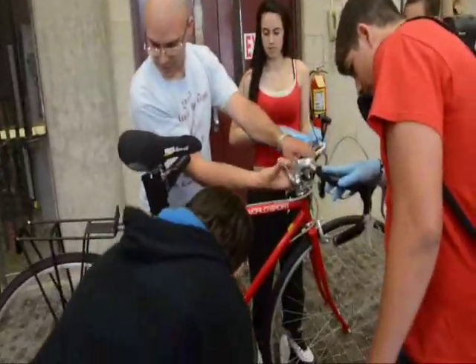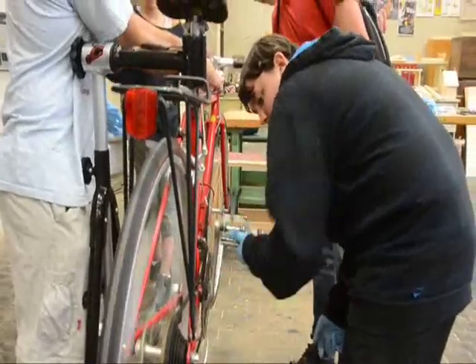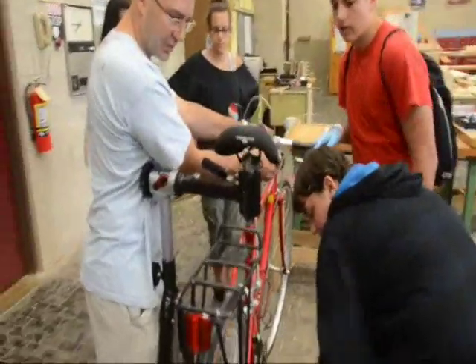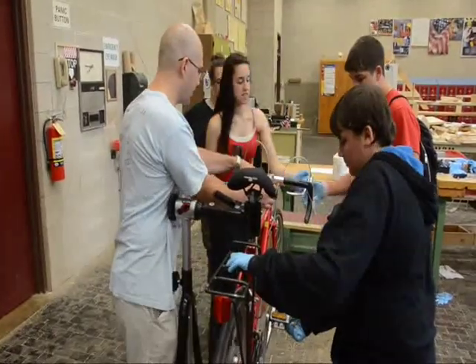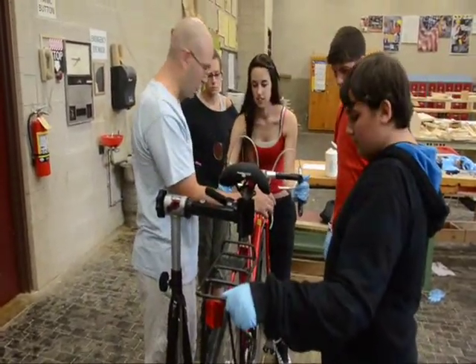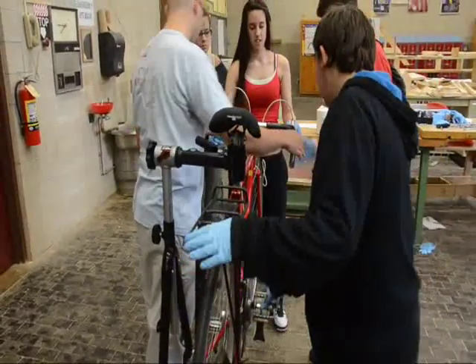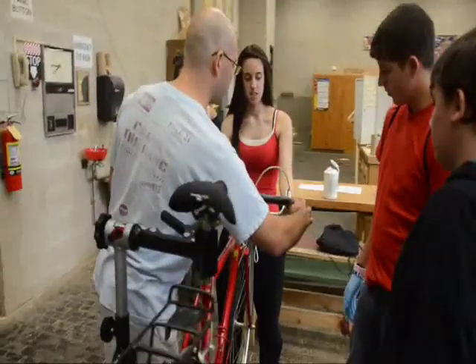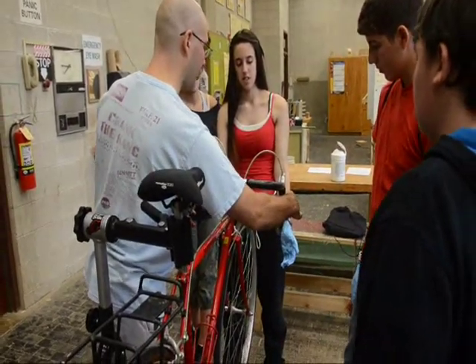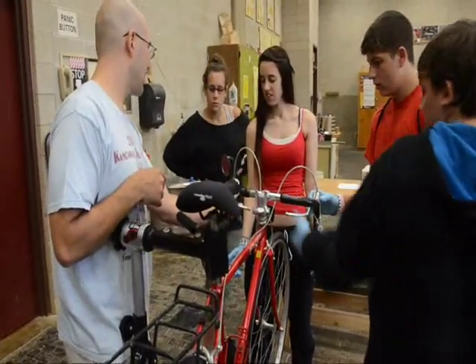How are we doing there? Is that going? That's fine. What's that noise? It's chain line. We just want to make sure it doesn't throw the chain. Seems like it's adjusted fine. Let's see the brakes. Good. Let's just see what they feel like. It's hard. This rear one could use some adjustment. You should be able to squeeze these brakes and still have a little bit of room left. But I can actually squeeze this right down. So this one's a little better.